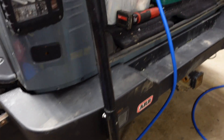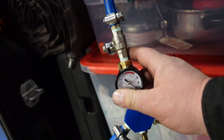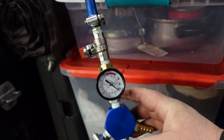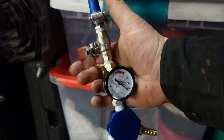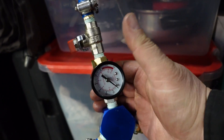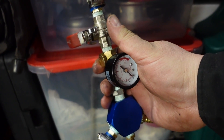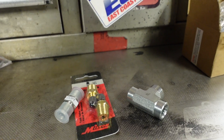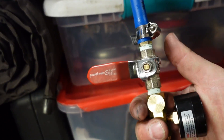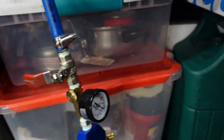I got one line ran, come to the back here, everything's plugged in. I changed around the ball valve configuration - I had the ball valve coming off the manifold which is kind of pointless because I wouldn't be able to realize how much air pressure is in there. The regulator is only going to slow the amount of air filling up the tires versus if I just went with the glycerin gauge in a T. Most times I'm probably just gonna crank it to max and fill up on max, but if I wanted to build up more pressure in the compressor versus filling the tires I might go that route.